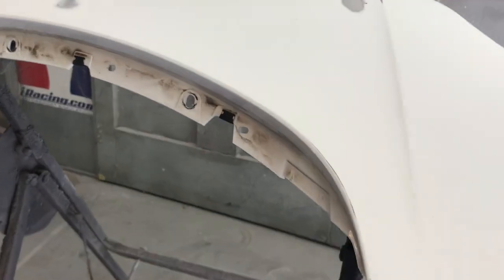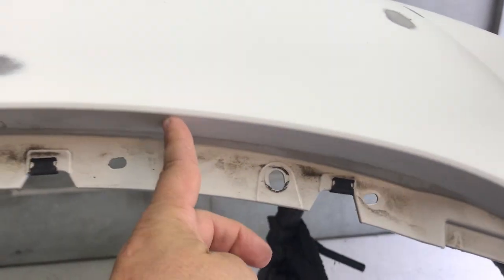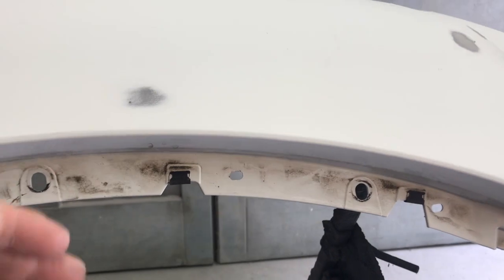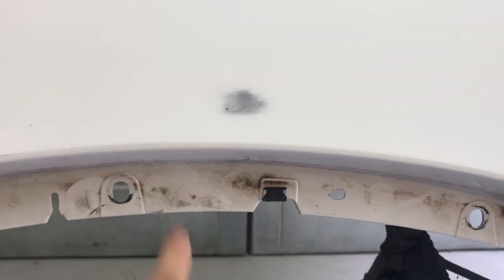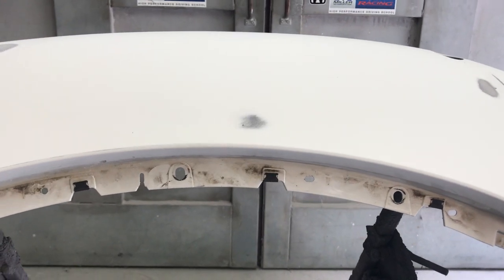If you have any more specific questions, leave a comment and I'll answer as best I can. When we're priming this bumper, I'm going to tape off this edge because it's not scuffed — it's only scuffed around the corner. Even if I scuffed it with a red pad I'd still tape it off, because if I prime down in there I'd have to scuff it again. So tape off all the edges you're not priming — there's really no reason to put primer there anyway.